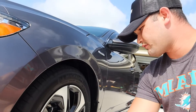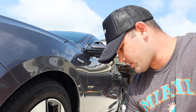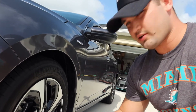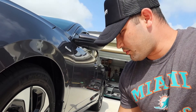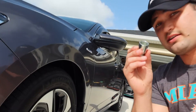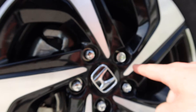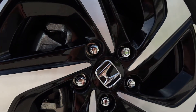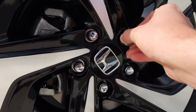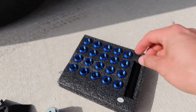If you want to attempt this project yourself and you're not car savvy, there is gonna be one wheel lock on here. What you're gonna have to do is get the wheel lock that's provided from factory. Here's the wheel lock — it's located in this little bag in my car. Since it's brand new, it was up here in the glove box. You're gonna go ahead and put this on the locking feature because you're gonna see one lug nut that's not like the rest — that basically prevents anybody from stealing your wheels. Here's your key and you just go on just like so.